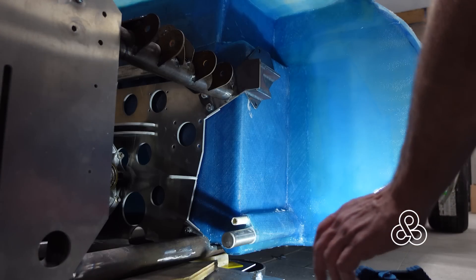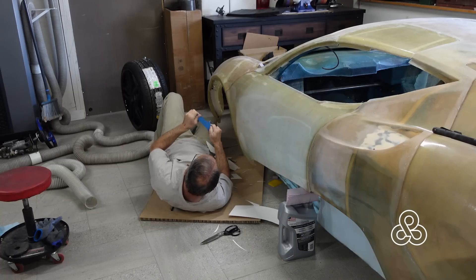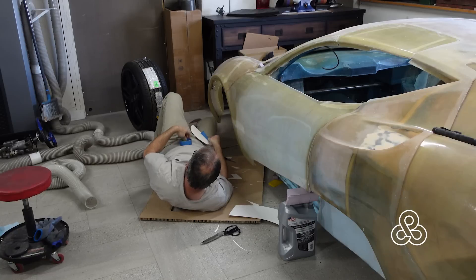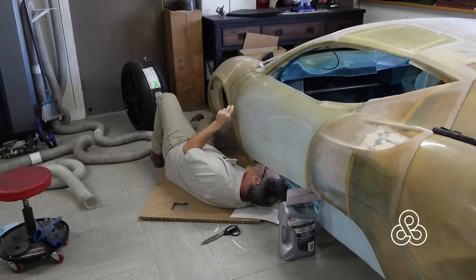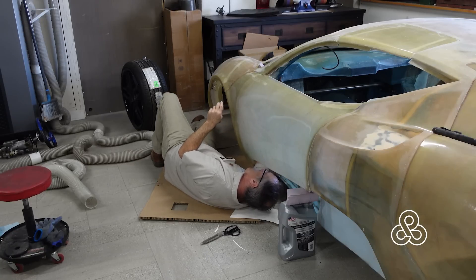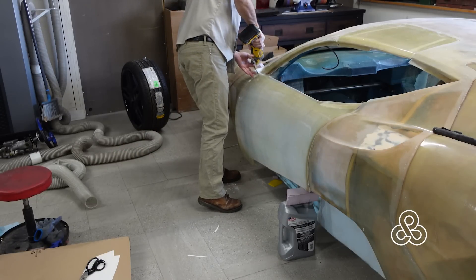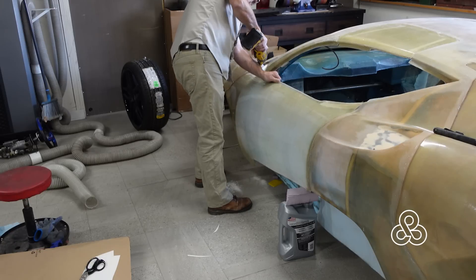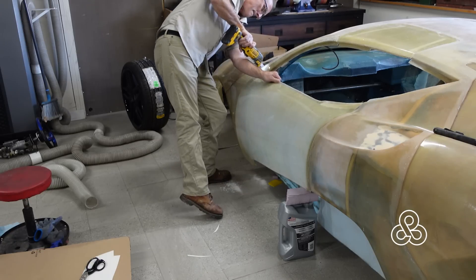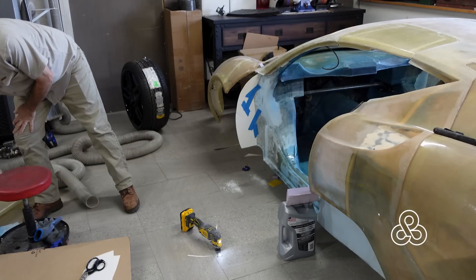There's this bulkhead or panel right here behind the front tire, and we're going to extend that out and actually fit it right up against the door skin. There'll be a bigger inside clamshell, but this would be forward of that. We want to have a little rubber seal on that as well that's going to close up against the door. I've created a template inside here and taped it in place right up against the door. Once I have that exactly where I want it, we're going to cut the door out — it is bonded in place by the A pillar. We'll cut that one last little cut where the A pillar is going to separate from the door. Pull it off and there you see the little template we just created on the inside, taped to that flat bulkhead.